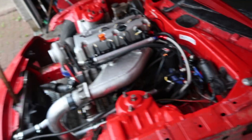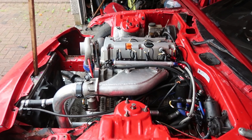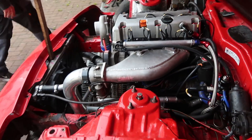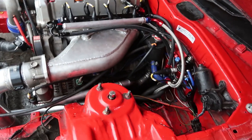What I need to do now is wait for the car to cool down, then I'm going to be pulling off the thermostat housing because that bush is leaking. I might actually pull off the inlet manifold - no, that'll be a nightmare. I'll take off these pipes here and I should manage to get to it. I'm just trying to remember if I've used allen bolts, or if I had the starter motor in when I put that in. It might just need to be tightened up, but it's maybe cracked - I've seen it before, just because of plastic.